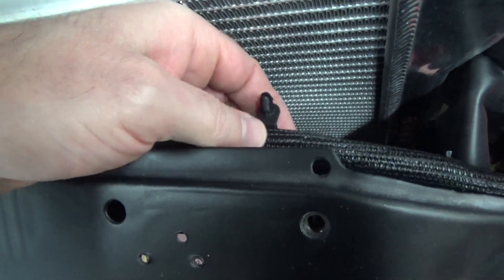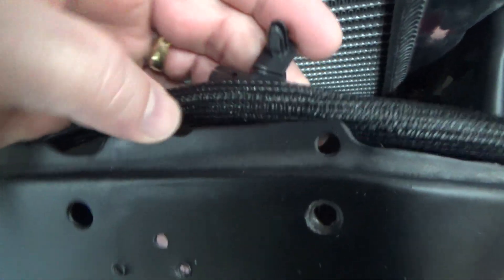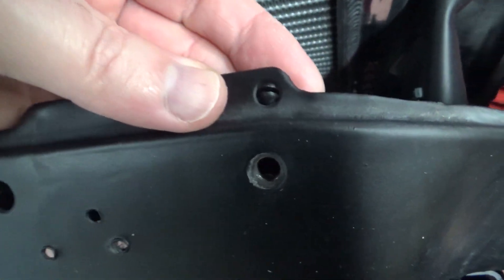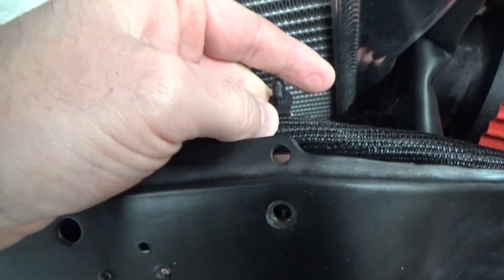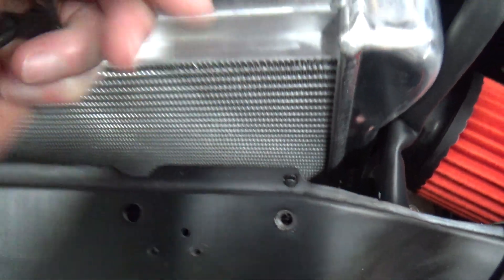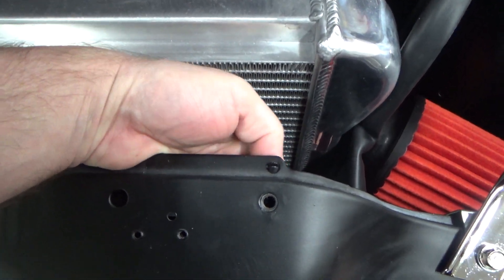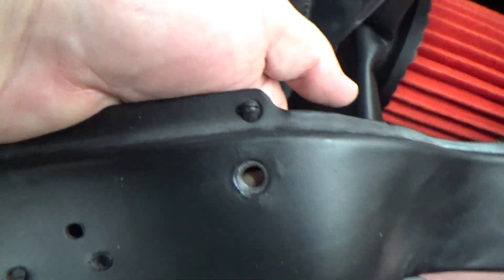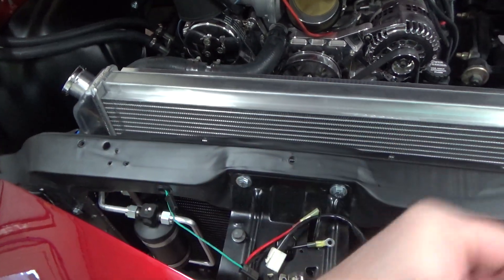I think I'll put at least one or two wire ties on it. That's pretty flimsy — you can see how it just pops right out. Get it in the right place and that looks like it's gonna work. Let me put a couple of wire ties on and see how it goes up under there. Worked like a treat — that's awesome. They've got this offset in them too, which pushes the wires under here. There's a bolt that comes through here on this one, which is a little goofy, but it'll push out of the way enough. I'll put these four in here so I can put the core support top panel back on and get all this locked down so it's not floating all over the place. If anybody knows other style clips you can get for these purposes, post it in the comments — for other people's assistance as well as my own.